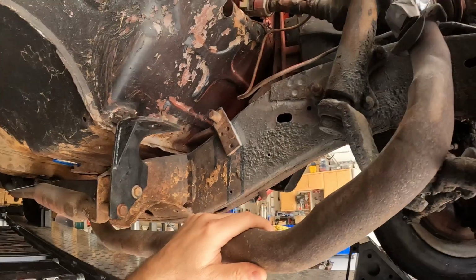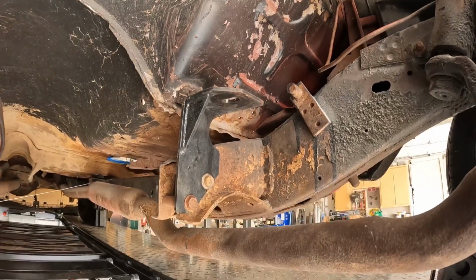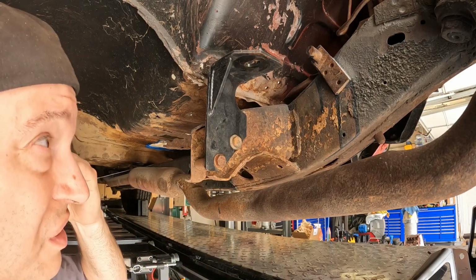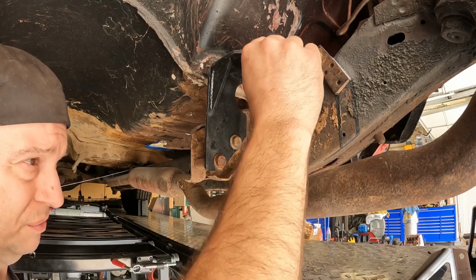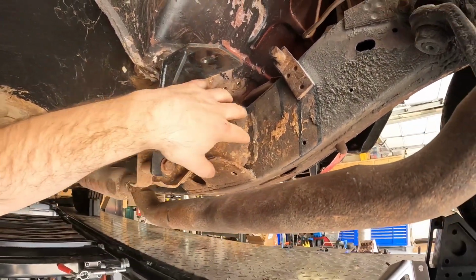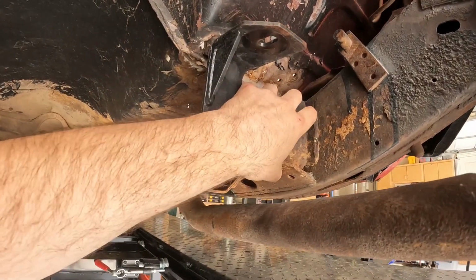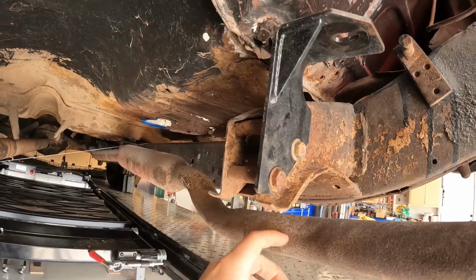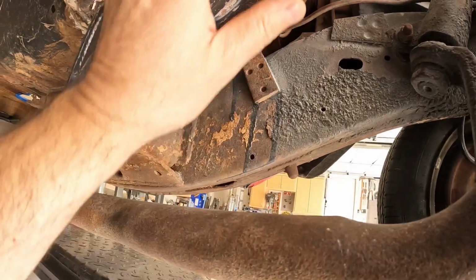So once I get the motor mounts in the front here, the Dirty Dingo mounts, I can remove the existing rear mounts that were bolted to the bell housing on the transmission. And I'm thinking if I'm going to take these out, then I might as well cut all of this crap out, this whole mount, cut this off of the frame. That'll give me more room for exhaust. Right now, this is just hanging loose because the motor's not in, but this will eventually raise up.